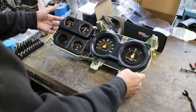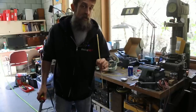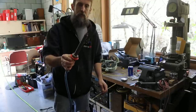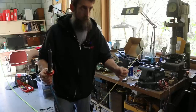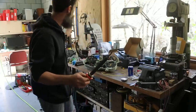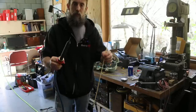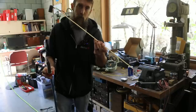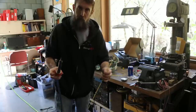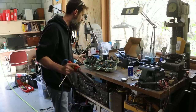I want to show you something at least some of you have never seen before — a plastic welder. They make these in different shapes and sizes, but all it really is is a hot air gun. There's a heating element inside that hooks to the airline from my air compressor. It's got an electric cord and blows hot air out the end. We can use that along with a welding rod — they make these in all sorts of different plastics — and weld broken or separate plastic pieces together. It's been around for a very long time; you just don't see it that often.